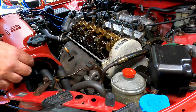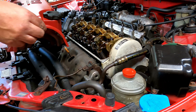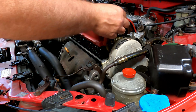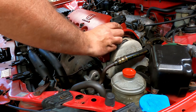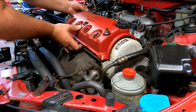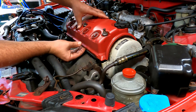Next it's time to just slip the valve cover on. The only thing that's even in the way a little bit is this vent hose — or vacuum hose — connected to the intake there. One thing you have to watch is these tubes that the spark plugs are in. You've got to have this lined up right or you'll just cut the crap out of those seals, and I just replaced mine so I'd rather not have to change them again.